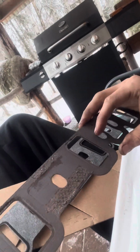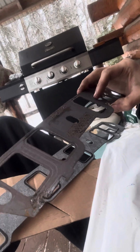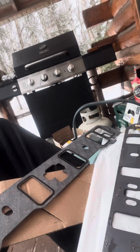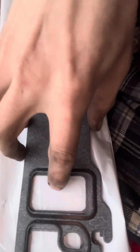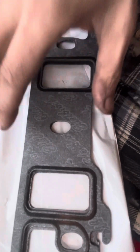Well, anyway, like I said, again, it could be a mistake in cataloging, but these gaskets are both marketed to be the same exact spec. All right. This is actually the 351. I think I got the 302 right here somewhere, but they match up perfectly except for the coolant jackets. But if you take the Edelbrock, lay it on top, the Edelbrock actually measures out perfectly, but you see all the problems here. See how that just don't line up? It's way too small, smaller than the stock size intake runner.